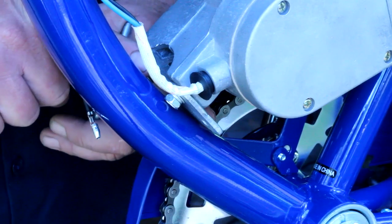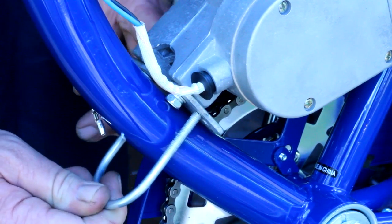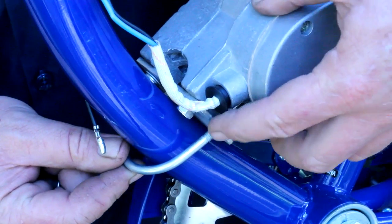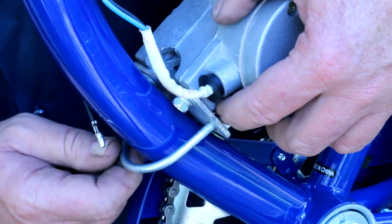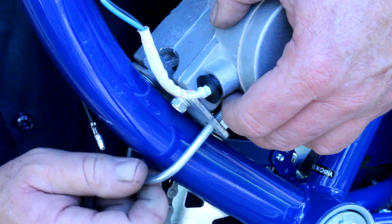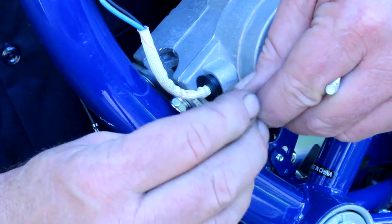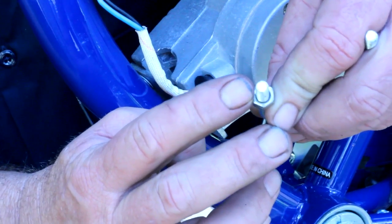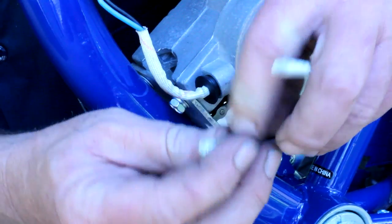Here is my U-bolt, which goes through the two holes and clamps against the frame. However, we have a problem — the U-bolt is too long and it's striking the motor. I still have about a third of an inch gap here; this needs to go in about a third of an inch more, so I'll need to cut about that much off. I'm going to put a nut over it, hit it with a grinder, cut it off, round off the end, then remove the nut to restore the threads. I'll go ahead and do both sides.